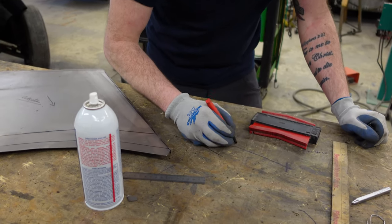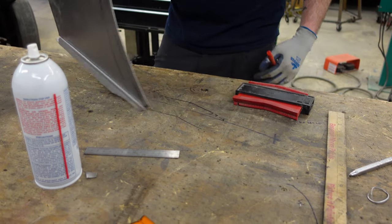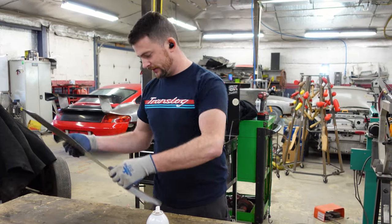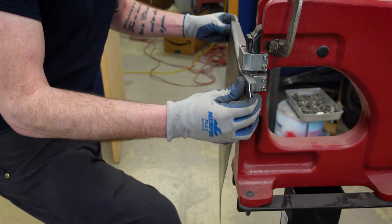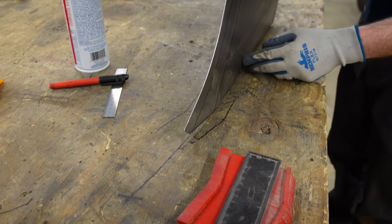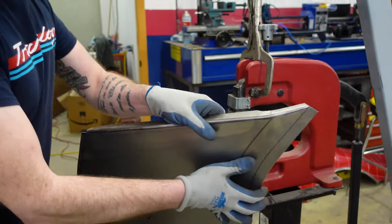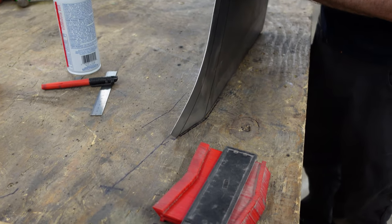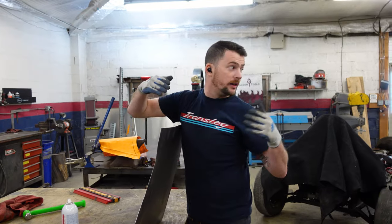I'm going to use the table — this is the front bar. All I have to do is lay this on the line and see when I have that shape, or I can hold the tool up. Sometimes you can't always trust the tool when you set it down because you might bump it and it won't be the same, but I can always repeat it. That's the secret. A little bit of hammer and dolly and it'll lay how I want it to. That's how you use a profile gauge, and I'm going to be using multiple sizes in this video to get both panels to match.